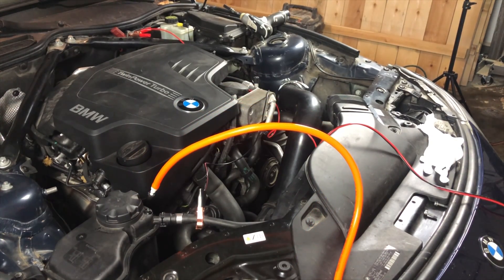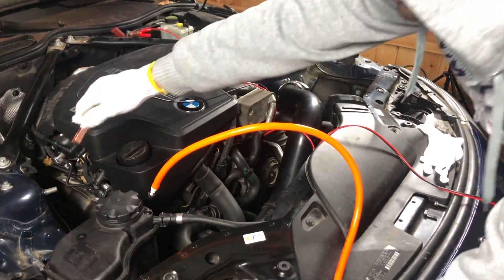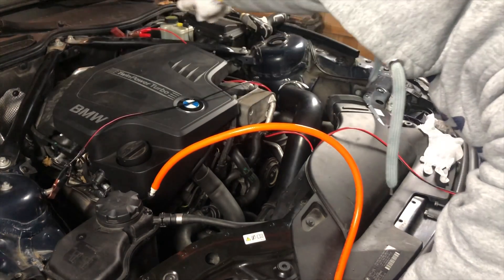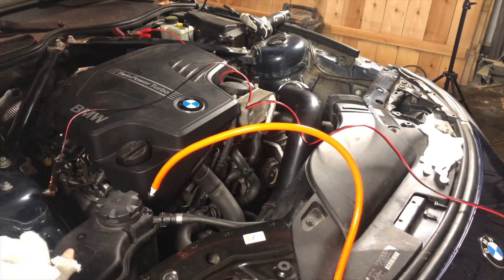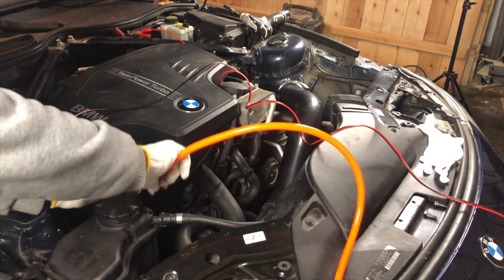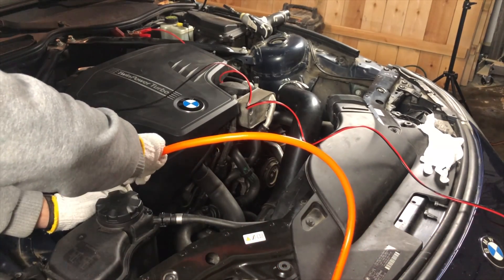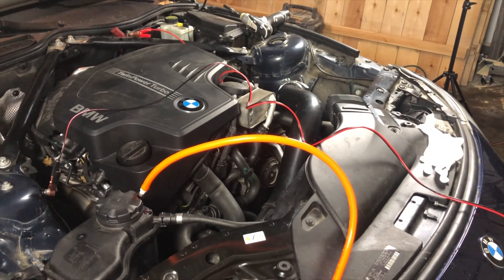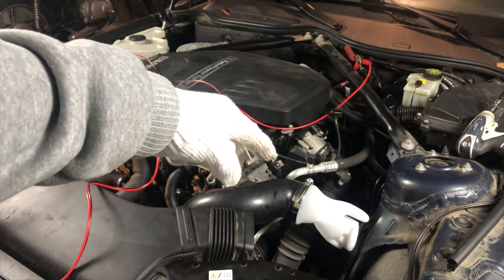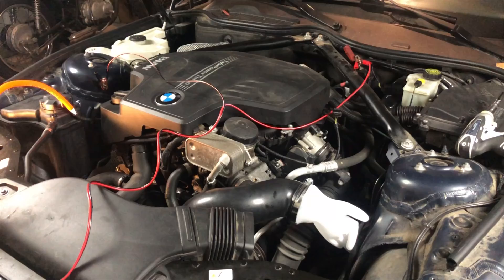I have now plugged in the air hose, so there's air moving into the system. Now we want it to be smoke, so we're going to connect the negative to the negative terminal — the positive is already connected. I check to make sure the smoke is coming out, then plug it back in and make sure it's tight. And now we wait. As you can see, we have pressure in the system — the glove has inflated and it's not leaking, so that works well for us. Now it's time to look for leaks.